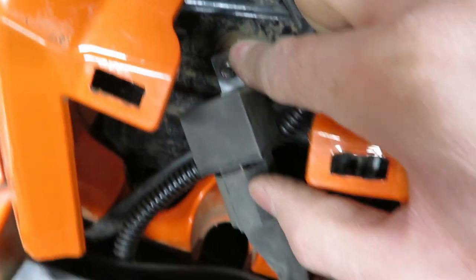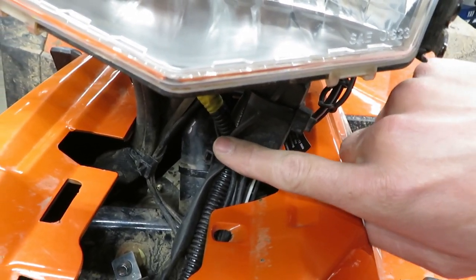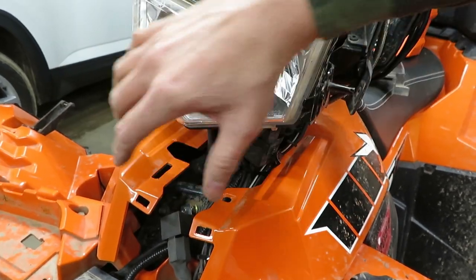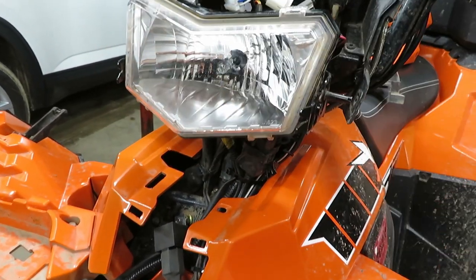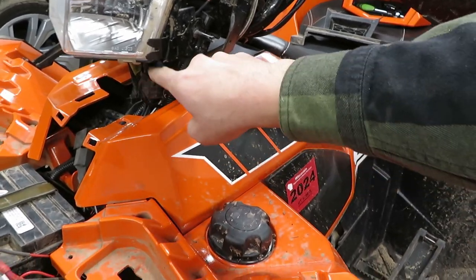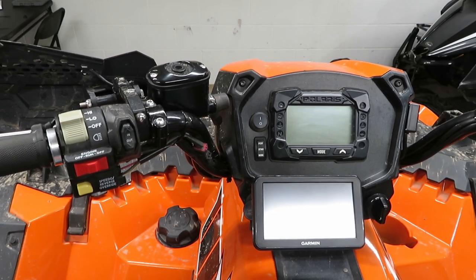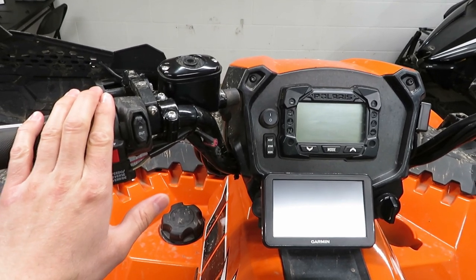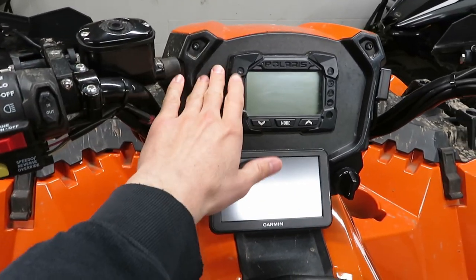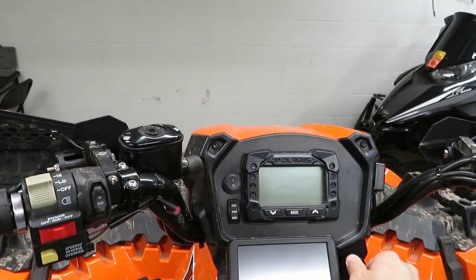The relay is anchored — I drilled the hole out a little bit and it fit right on top of the end of that. I ended up moving the majority of my wires over to this side, which is kind of nice because then it's more centered — so when you're turning, you're not swinging it from one side to the other. I'd recommend turning your key on so you've got your EPS activated, then steer back and forth a couple of times just to make sure you're not yanking or pinching any wires. The real beauty of this kit is that the 12-inch light bar is now going to be activated by your normal high beam switch. If you hit oncoming traffic, all you have to do is flip back down to low — you don't have to fumble with a switch. It's just one switch. The light turns off, the light bar turns off. Absolutely love that — definitely the way to go, much safer.